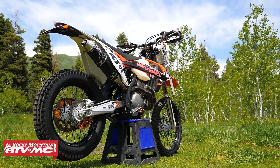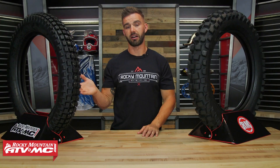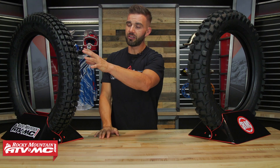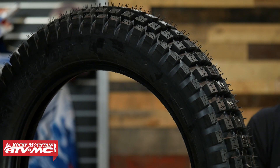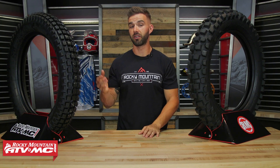Now over the years, there's been a lot of off-road riders, a lot of trail riders that have been switching over to a trials tire, and that's for good reason. A trials tire — you can see I've got one right here on my right — these are designed to have a larger contact patch, a softer sidewall so they're more flexible, and they use a softer, stickier rubber compound. So these things hook up absolutely awesome in your rocks, your roots, and your other slick surfaces.